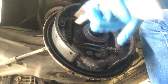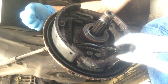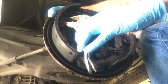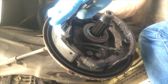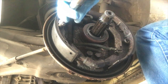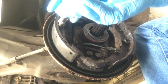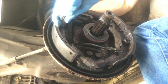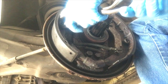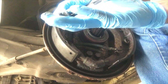Now these are the brake shoe retainers. I use a vice grip to get them off by pushing onto the back and getting the vice grips just tight enough to grab it but not crush it. You get a nice little bite on there, and then you give it about an eighth of a turn doing it this way. There is a special tool for doing this — I have never owned it. I've always used this exact pair of vice grips.